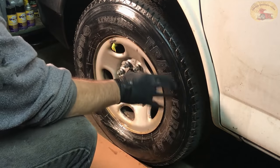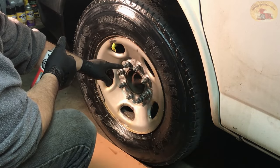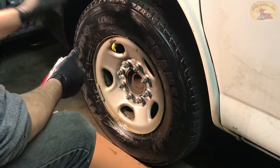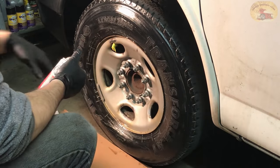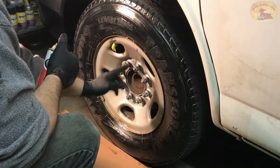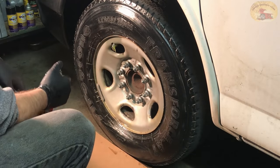All right, we've got it all coated, it's all done — took about three minutes and it's fully protected. We're not going to worry about the threads and the studs here, but if you are, you can coat each one with some Vaseline or petroleum jelly and it will keep the paint from adhering. Now on the rusted areas we are going to spray etching primer, and then standard automotive primer on the rest of it.